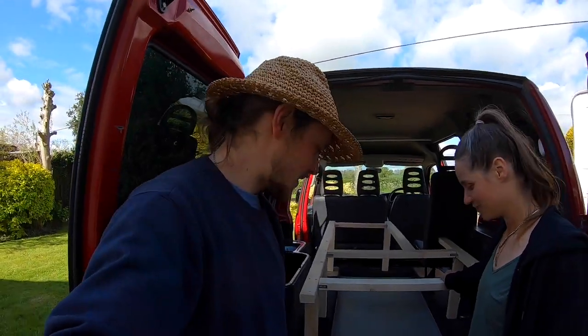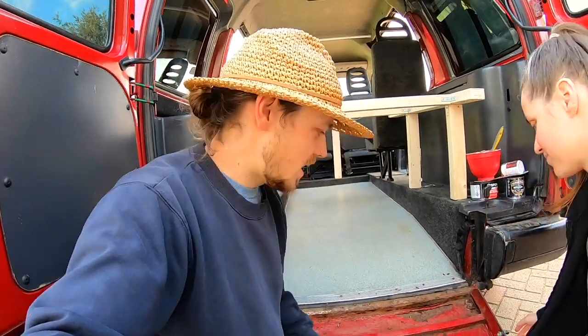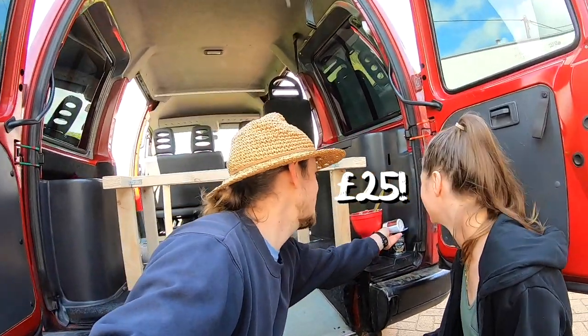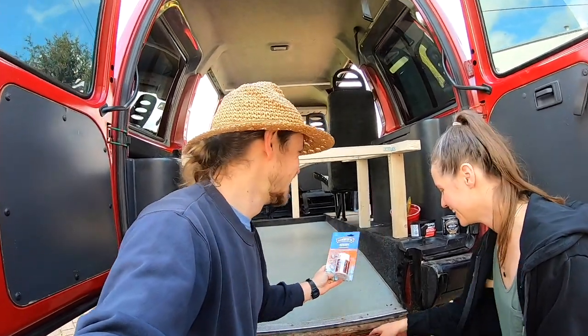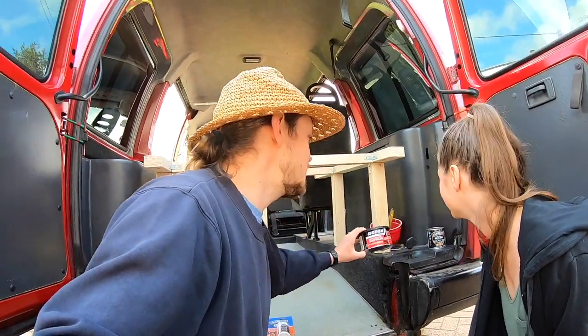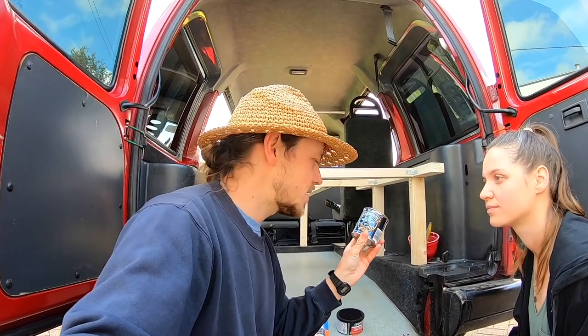So the plan for today — we have to deal with this. It's nothing structural, but we've got a bit of a rust hole in this back hatch. We've got a three-part method for dealing with this, which we only found out yesterday. The first thing is to put Hammerite on it — it converts rust into a stable surface in just 15 minutes. Then we fill it with as much body filler as possible, and third we put some paint on it, which will help prevent the rust from coming back.